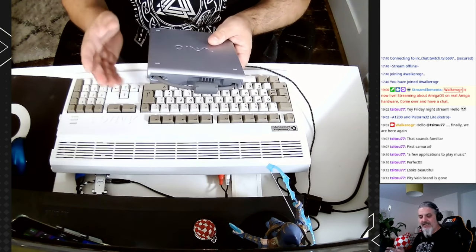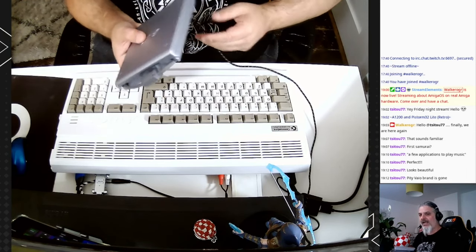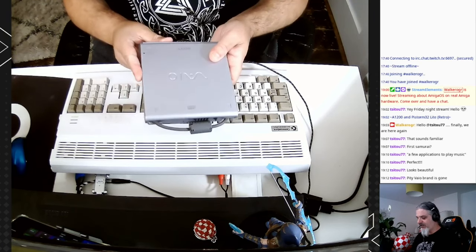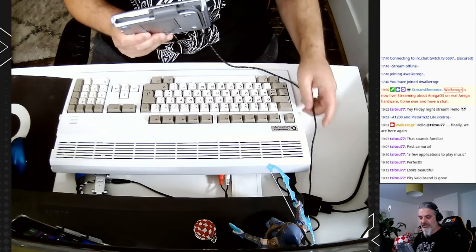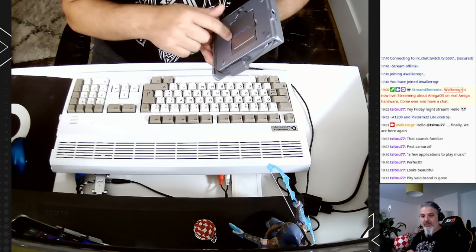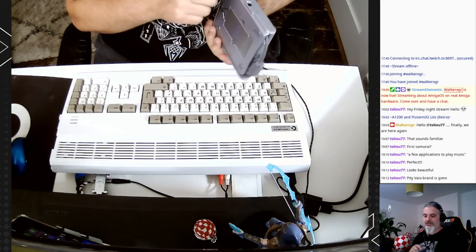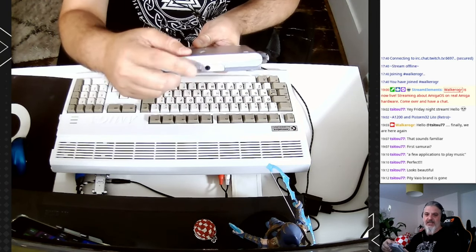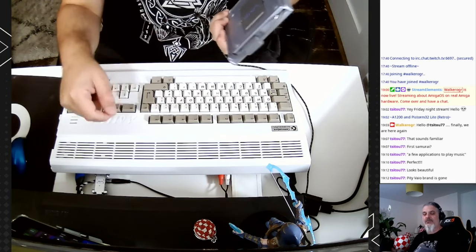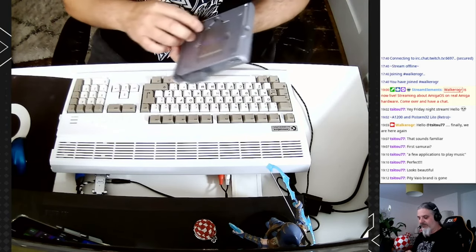It is one of the hardware that recently we got drivers for, and since then it is not that easy to find this kind of CD-ROMs. But it is great, and I think it works perfect with an Amiga. The only downside when you are using a PCMCIA CD-ROM is that you can't take the audio from the PCMCIA, so you have to connect through the audio jack of the CD-ROM. That means you need to change the output of the speakers that you are using for your Amiga and connect it to the CD-ROM, but that's not a big deal, I guess.